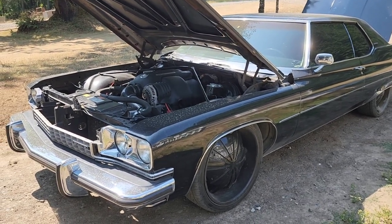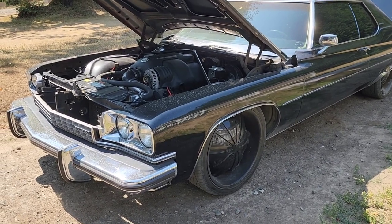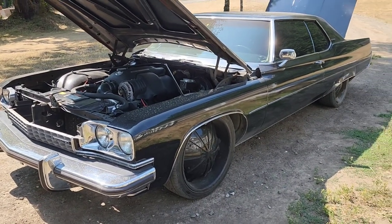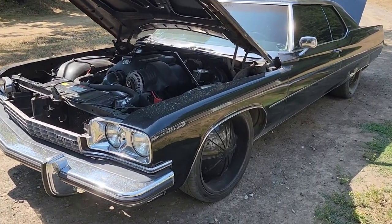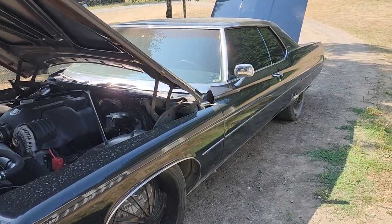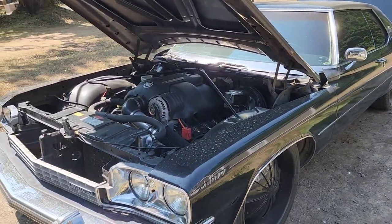We blew the upper radiator hose because the fan shroud was eaten up a little bit, and it nicked the fan. And luckily, I had a bunch of parts for one of these, so we fixed it up, made it home. Anyways, got it back. The motor was tired. It was an Arizona car. The interior was, you know, Arizona car. There were cracks in the dash, seats were torn up.